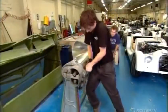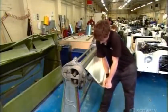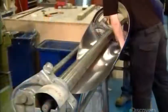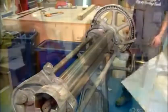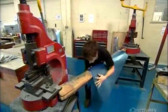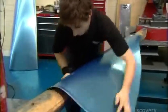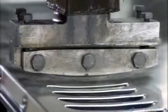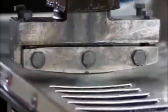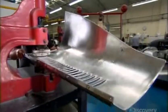Two bonnets form the car's hood. To make each one, a craftsman feeds aluminum through rollers to curve it, then massages it over an old log that this factory has been using for this purpose since the 1930s. They put each panel through a press that cuts louver holes. In the old days, the purpose of louvers was to ventilate the engine, but now they're mostly for style.